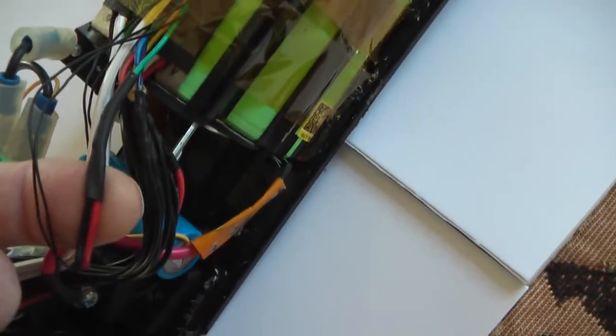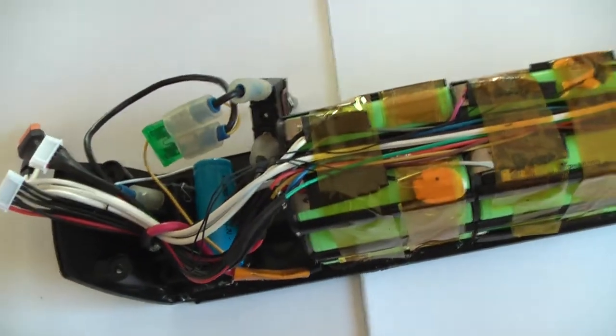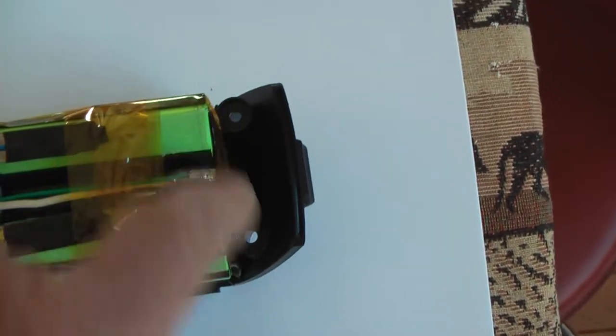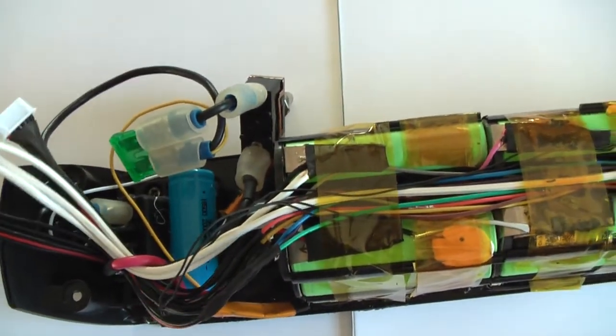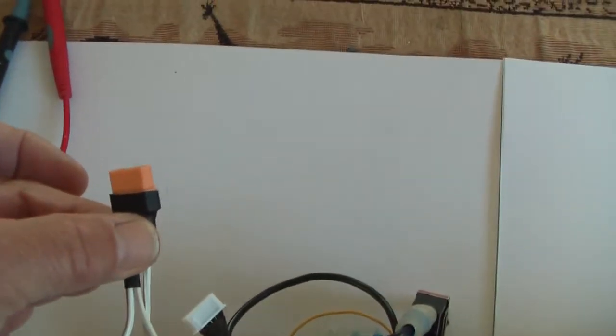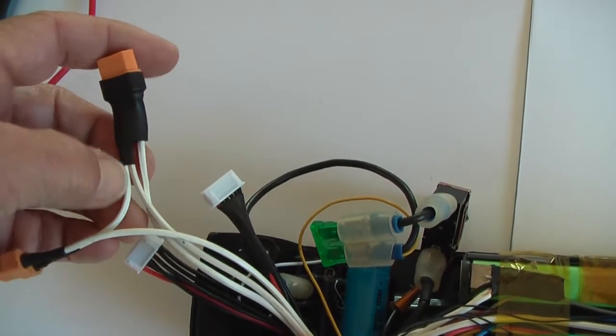You see, two wires are leaving the green wire. More or less the same for the white charge wire that runs over there to the crossing over there. That wire is the plus wire for the connector that serves 0 to 18 volts. So that's why it runs in here.